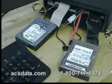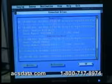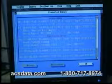And right now I'm just watching on our screen here, waiting for the drive to come ready. It's showing as busy right now. Sometimes when you replace the heads, it takes a little while. Sometimes the drive will actually function in somewhat of a degraded state, especially with these drives where the head alignment might not be exactly like it was before.